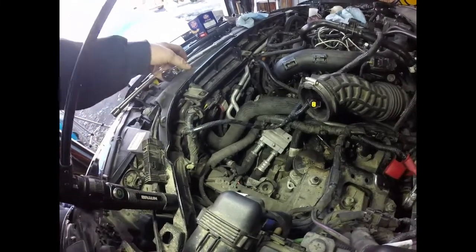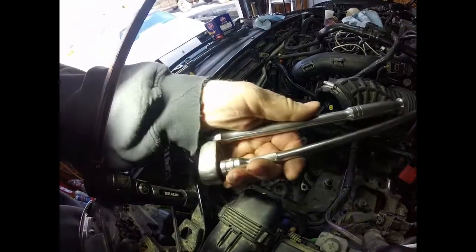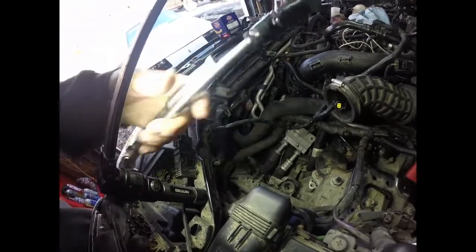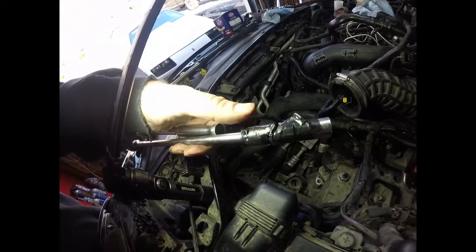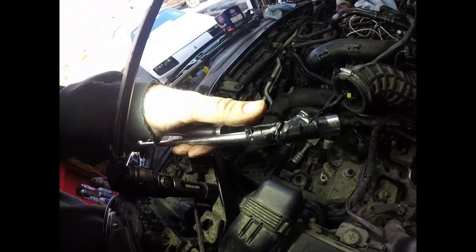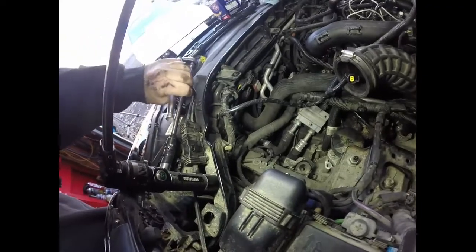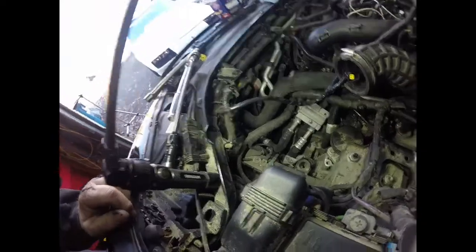Here is the reason why you have to remove the shifter cable in the first place — you have to get your tools down in there where that top bolt is. Here is what I did: I used a 10-inch extension with a knuckle — there is a knuckle underneath this tape right here — and a 13mm socket. I taped a small layer of tape around the extension, the knuckle, and the socket so that it does not fall apart when you are in there, because if it drops down in there you might have a big problem getting it back.